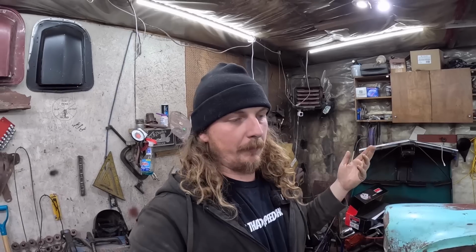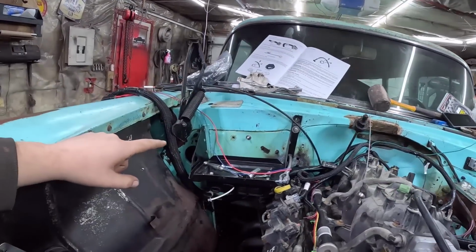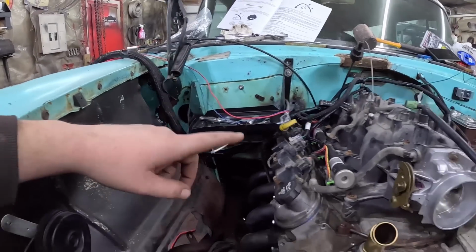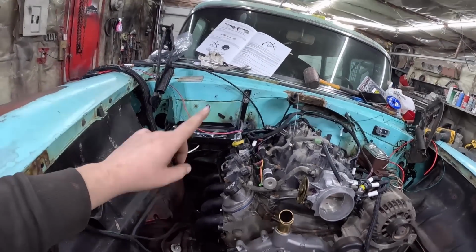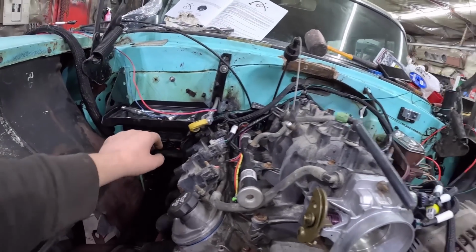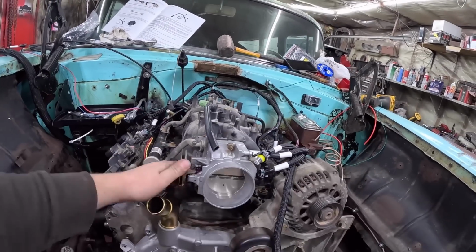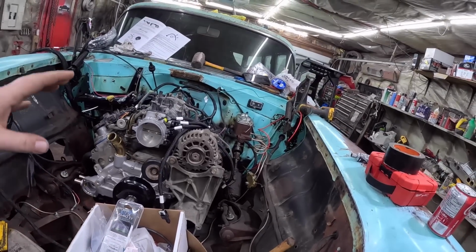Obviously we're going to run with no coolant, just to kind of hear it burble. So we've got to put oil in and the filter on. I got the battery tray set up where I want it. I had to tilt it a little bit, it looks goofy or not, to clear the coils. But I have plug wires, we'll do that. We can get to everything very easily. Just plug all that in. We've got to ground the coils real quick. Obviously we have no throttle cables. There's a few things like that we've got to go through, but get it all together.